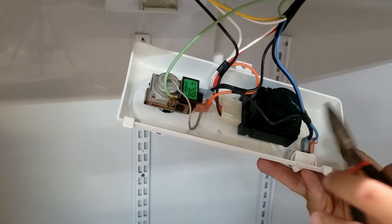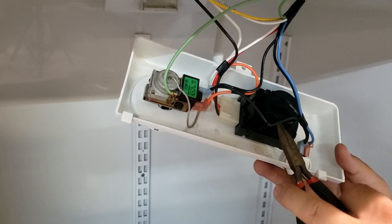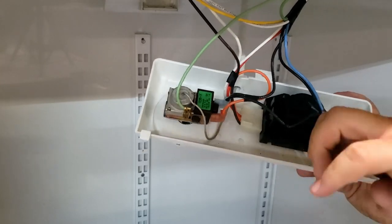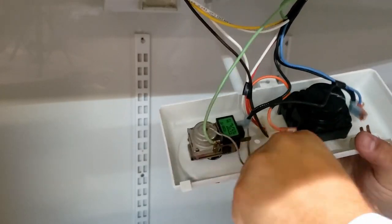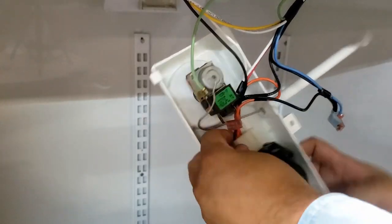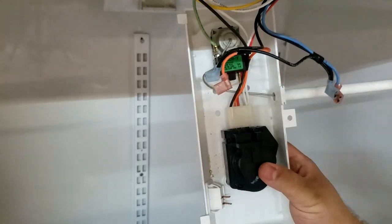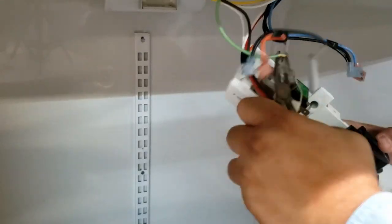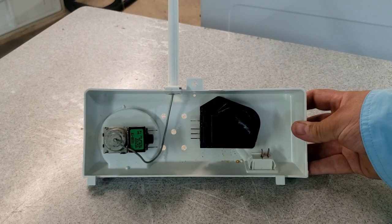I'm going to use a small pair of needle-nose pliers to make this easier. Inside this assembly there are only three components — your refrigerator may have a slightly different configuration. The wires on the right side are a switch to a small heater between the doors. The black piece is the defrost timer, which controls the refrigerator shutting off to clean ice off the freezer evaporator. The left piece with the green tag is the thermostat that tells the refrigerator when it's cold enough to shut the system off and save energy.